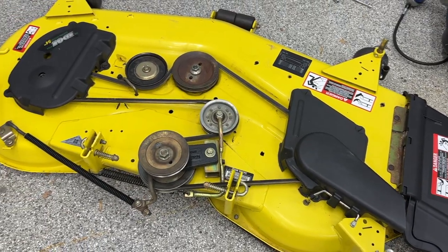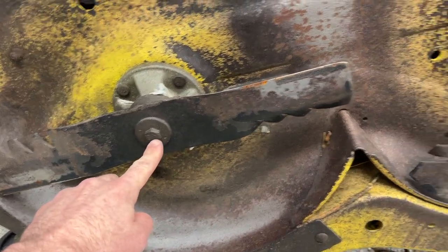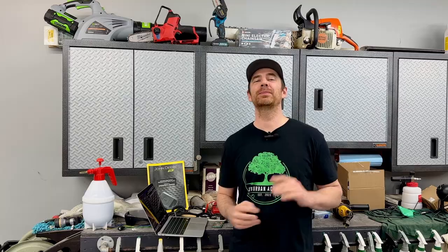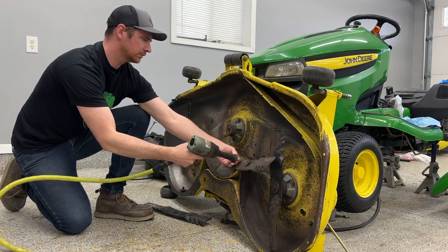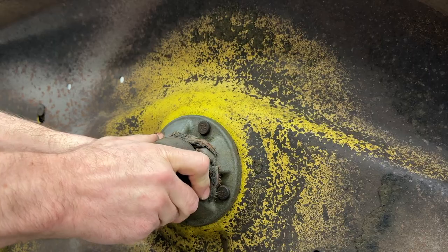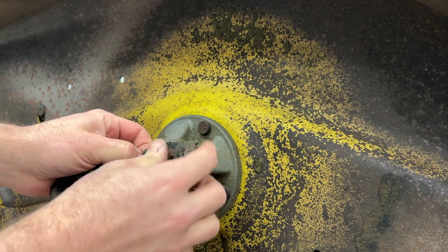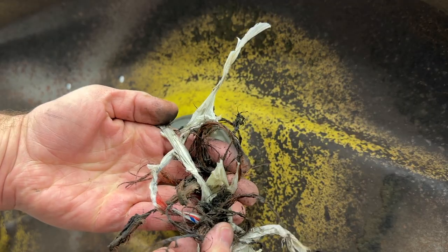On to the third step: the blades. If you're anything like me, you run over sticks and rocks and crap all the time and your blades are probably pretty beat up. Now is the easiest time to get access to them to pop them off for a quick sharpening. Have you ever hit an object with your mower blade so hard that the engine actually shut off and you had to restart the mower? I have — it was a tree root. Flip the deck up and using an 18 millimeter socket and impact wrench, remove the blades. They're held on by one bolt each. I also noticed a plastic bag wrapped around one of the spindles from last summer — pull that spacer off behind the blade, get that plastic bag out, and check the other spindles for any wrapped-up grass.